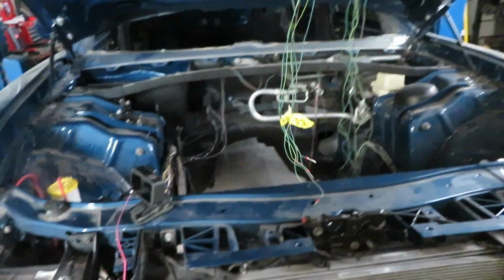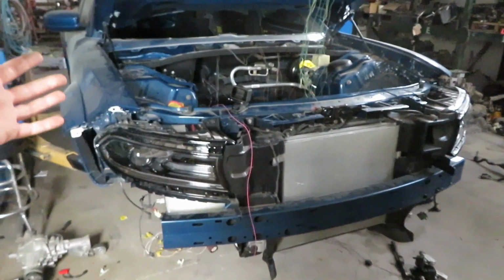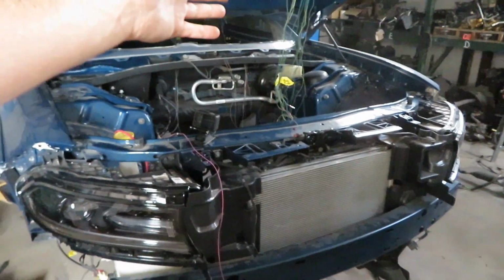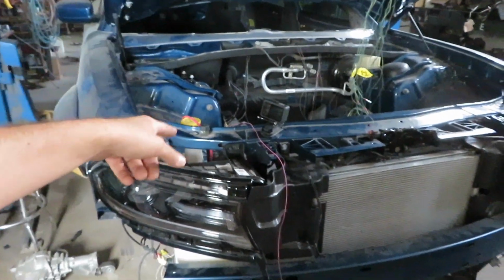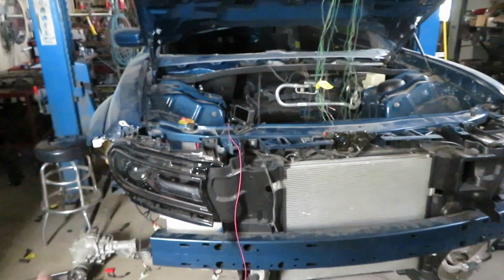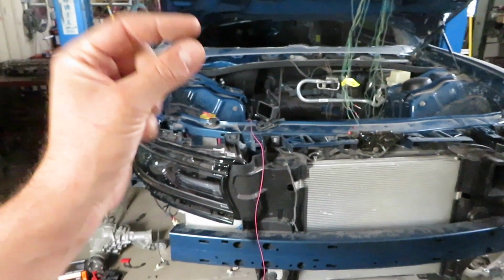So it'll just save us a lot of headaches in the future, just in case I have some issues where there is a resistance issue, then I can go in and I know that all the wiring is factory Charger wiring. So I could change that, I believe, in the ABS pump and the BCM for CAN bus. But everything should be, I believe it's 120 ohms, and that's why those resistor packs are in there.